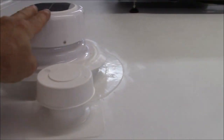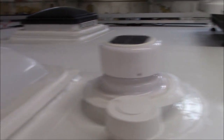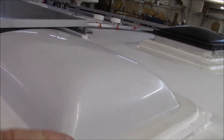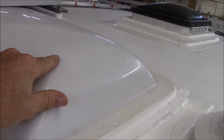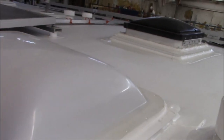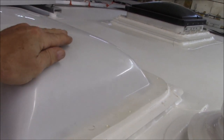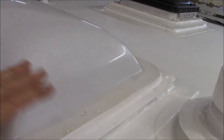So we made these through. This is a solar fan, this is plumbing, there's a solar fan. Typically what happens on these lenses is when the dew sits on there, especially in the spring or the cooler mornings, you get some dew on there. When that dew's sitting there, not only is it on the top, it's actually on the inside, up underneath. Now the sun comes up and evaporates the top, but what's up underneath, the UV light can't get at to evaporate it. So it just condenses, and then it rolls down on the inside of the lens. That's how you get what's known as dry rot.